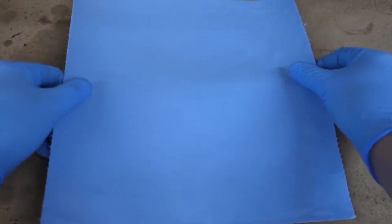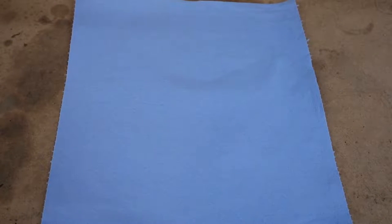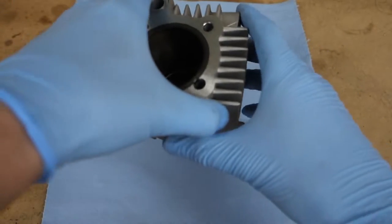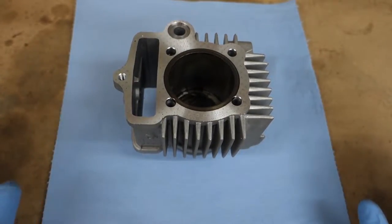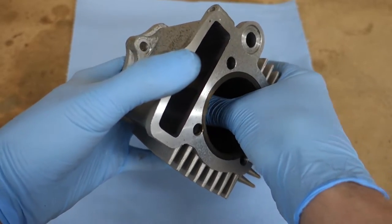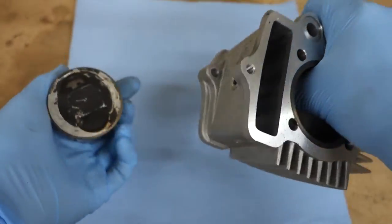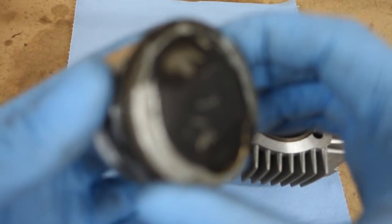As we gaze at my stained workbench, put this here for a sec. So I kind of wanted to go over what happened to this bike the last time it was an 88. We were doing the M1GP 24-hour at Willow Springs, and we were running this Tbolt kit, which is great. And we got the race head and everything on it. The only thing was, this kit runs 13:1, and we were only allowed to run pump gas.